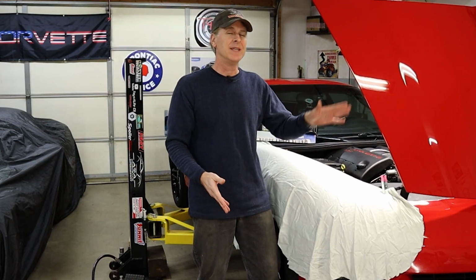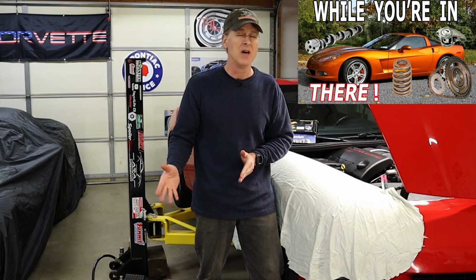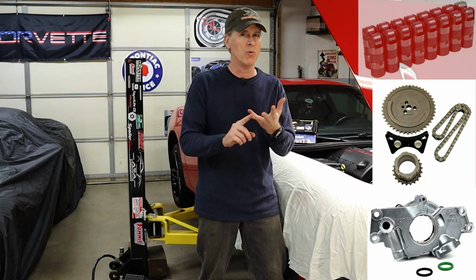After that video, I did another one where we discussed the components that you really need to replace along with a performance aftermarket camshaft, things like performance valve springs and chromoly push rods. We also talked about other components that you may or may not have to replace depending on your situation and budget, things like the oil pump, the timing chain set, and roller lifters.